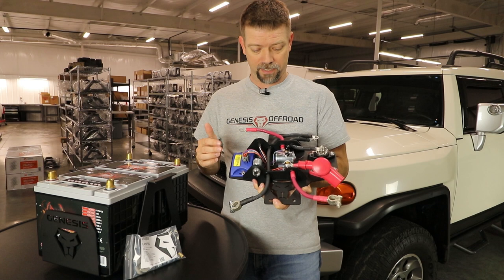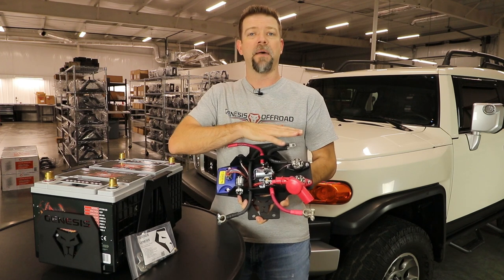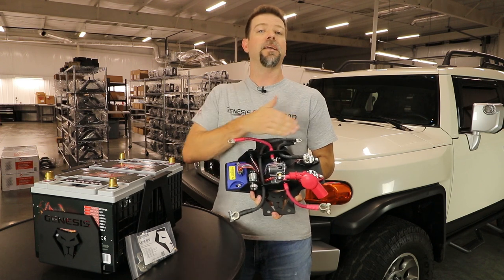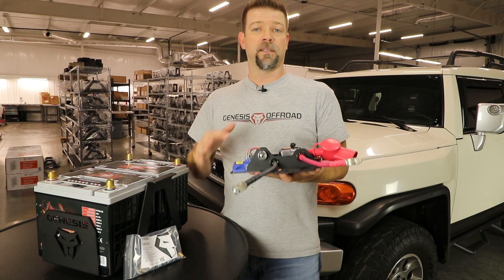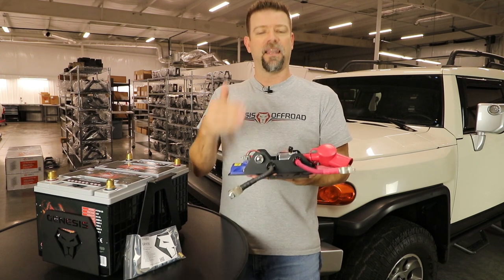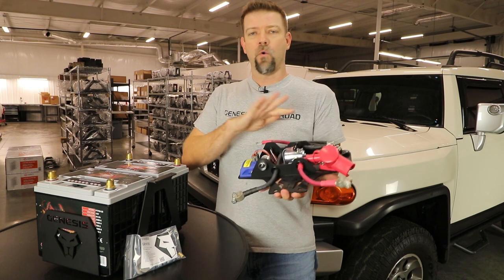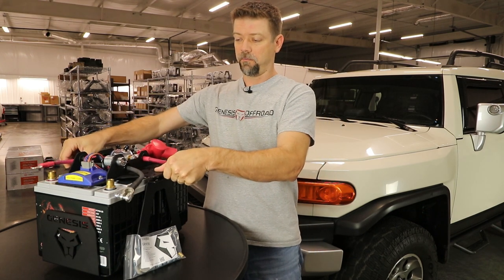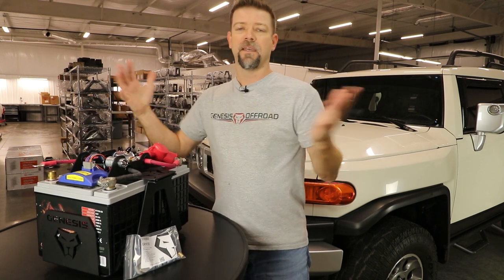We want to keep your wiring nice and tidy. All the accessories you have on the bus bars can drain that accessory battery down all the way until it's completely dead — you don't care how low that battery gets, you just want to be able to start up the engine the next morning. This system will protect your cranking battery from getting drained down by your aftermarket accessories. You also have a boost button here — if your cranking battery gets drained down and you can't start the engine, you can hit this button one time and it will send the signal to connect the batteries manually, letting you use the power from your auxiliary battery to help start the engine. This comes all completely pre-wired — no wiring for you to do at all, no modifications to your factory wires. This sits right down on top of the batteries and holds them in place, and you bolt the lid down with four bolts.